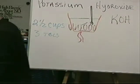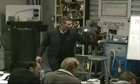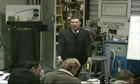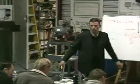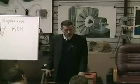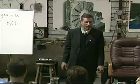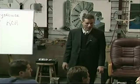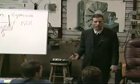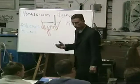Glass will not react. If I took this aluminum can and I poured water in it and I poured the potassium hydroxide in, it'll eat right through the bottom of that can and spill the caustic all over the place. I usually use cold water. It ain't gonna stay cold for long is what I'm trying to tell you. Gloves, you use pretty much the same process. So use a glass container when you do your mixing. Mix it slowly.